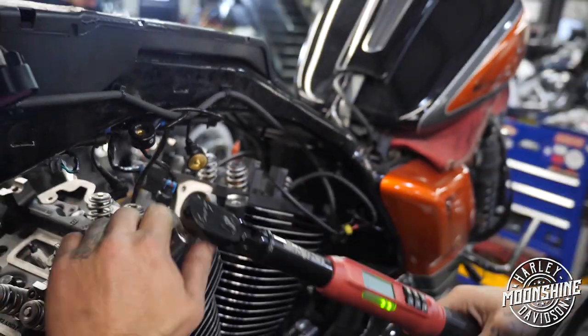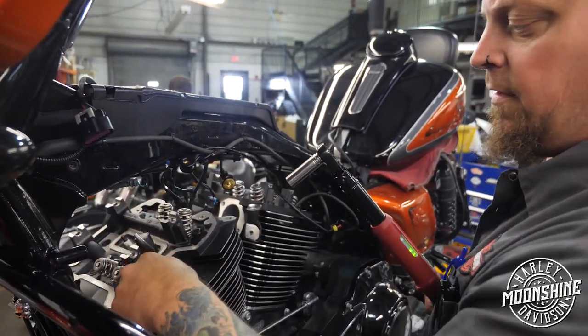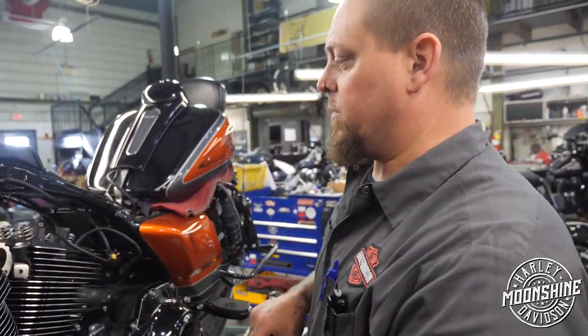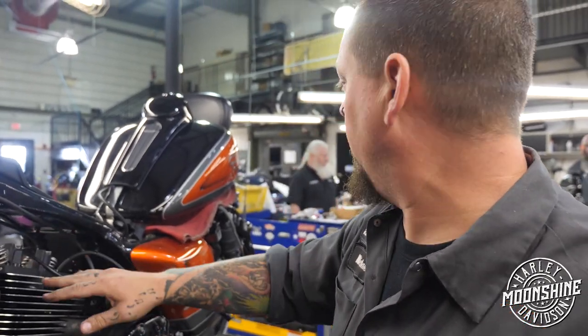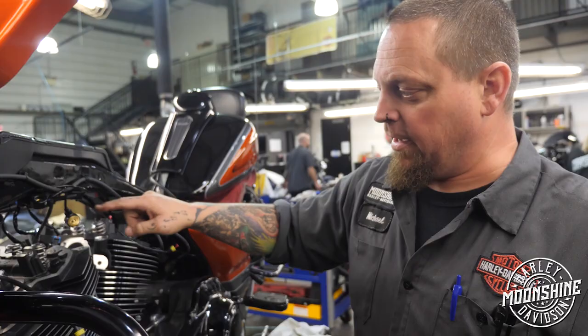And then I'm a quarter turn light on all three of these, and this one is over by 2 pounds by the time I get done with the first actual sequence. So this head is already tight. And at the end of their sequence, when you go to 45 pounds, it says wait 15 minutes and then check them all to make sure they're at 45. So that's all we're gonna do. And I did this one ahead of time so that we can do it immediately after this.